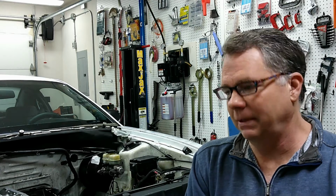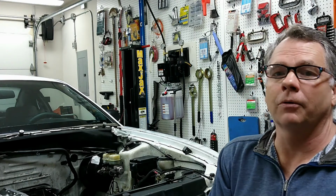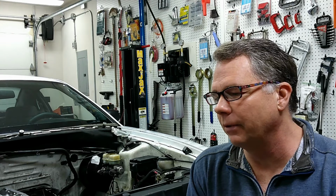And as far as putting it back together, it's going to be just the opposite of what I did to get to this point. You could probably watch the first 5 or 6 videos in the series in reverse and see where I'm going. So I'm going to be fairly brief putting it back together, with the exception of things like the cylinder heads, the lower intake manifold and upper intake manifold, which require a specific torquing sequence. So I'll go into more detail at that point.